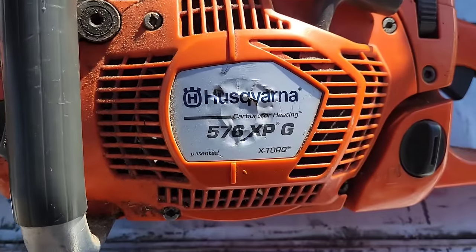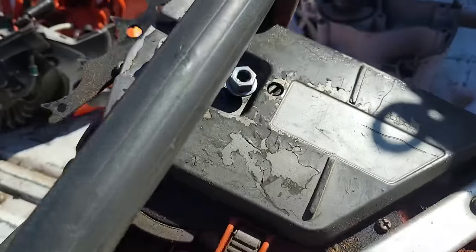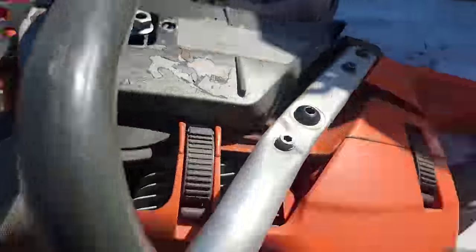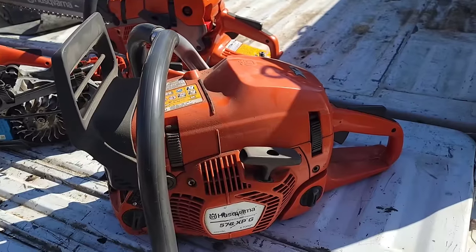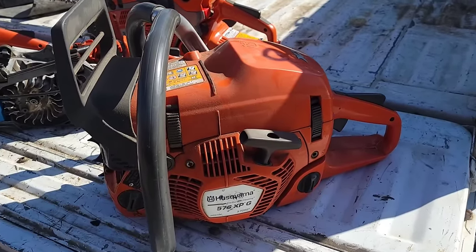This saw had a blown up set of crank bearings and a scored top end. Okay. When we first were looking at these saws, we made our mind up. These are no good. They have plastic bearings. I remember looking them over with him. And he's like, look at these things. And then he threw a couple together and we started running them. It's like, wow, this thing's smooth. Wow, this thing makes power. Wow, this thing runs hot.